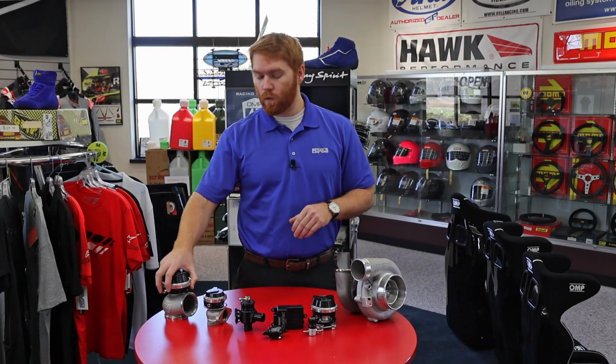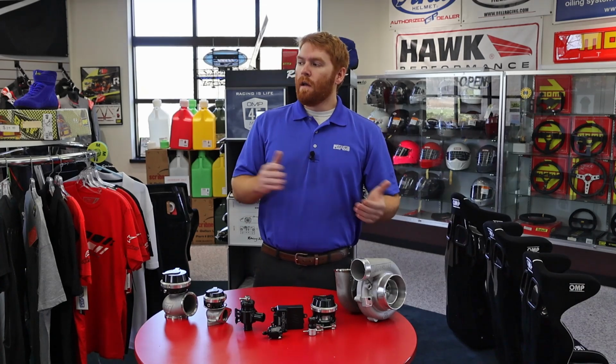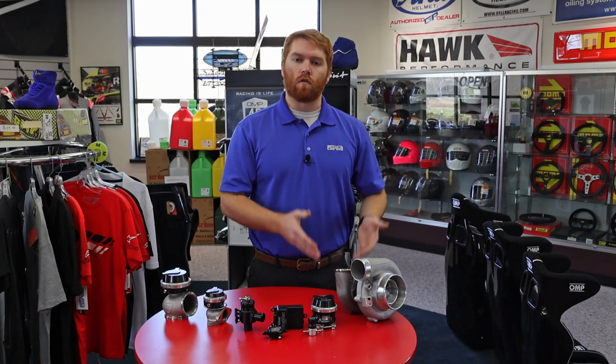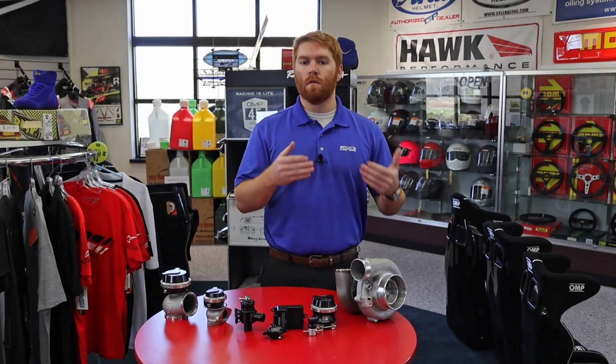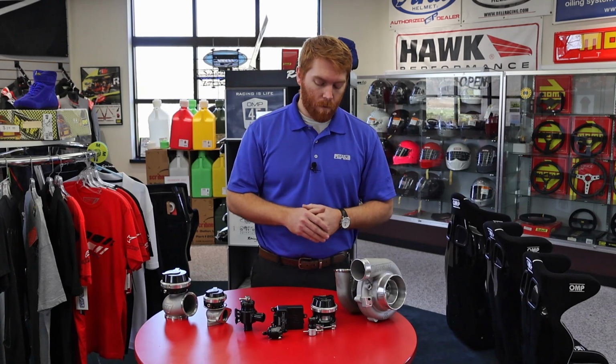And if you let out too much air, you can actually reduce the energy that's going into the turbo a lot more than you're planning on. The reason that is an issue is it can cause boost surges and issues with not being able to control the boost exactly how you want to, how smoothly you want to, and all that is really a problem. That's the hot side of things.